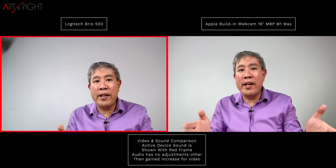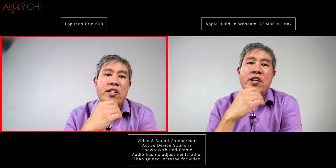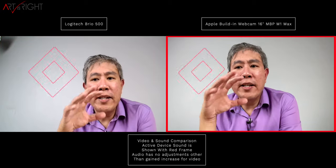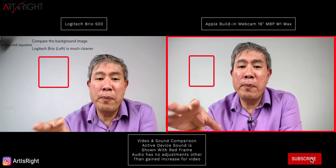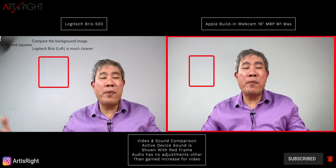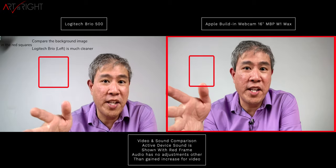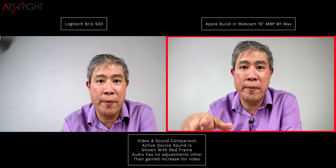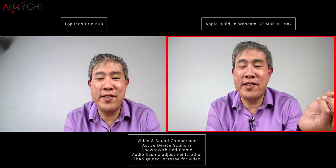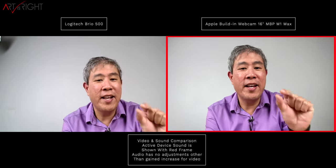You can see it's a little wider than the 16-inch MacBook Pro's built-in webcam — you can spot the slight corner at the very top. The angles are very similar and the cameras are almost right next to each other. As for image quality, the MacBook Pro has a great camera, but looking at it right now there's a lot of noise and artifact happening in real time, even in a fairly bright studio. When you look at the Logitech Brio clip, the image is sharper and there's less noise and artifact. This comes down to the dedicated signal processing chip and the better, deeper lens inside the webcam.